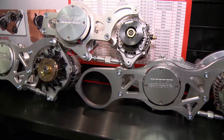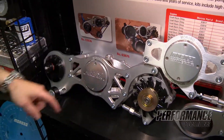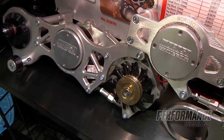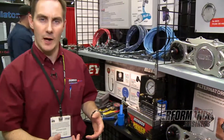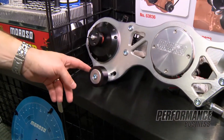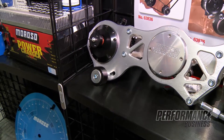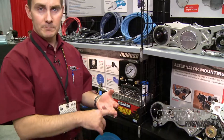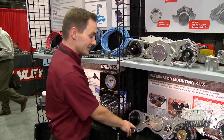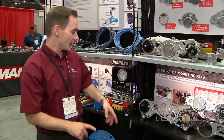Some of the newer features of these brackets include a double hung bracket which will incorporate the new 130 millimeter case alternators for larger amperage usage — for the Pro Street style guys that need more amperage. We also have a tensioner built into this unit which allows greater flexibility on pulley variations, whether it be a V-belt pulley, V-rib pulley, a cogged pulley, or any kind of HTD drives. It gives you greater flexibility with respect to drive ratios, types of pulleys, and belt length. You're not fixed into a belt length, which makes it very nice to have a tensioner on these things.